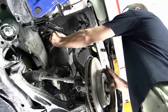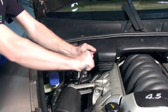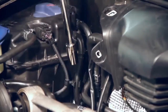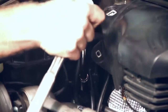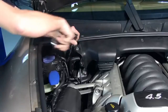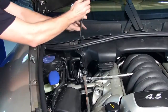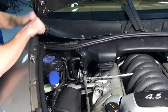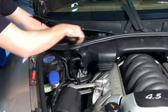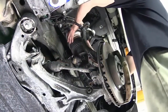Remove and disconnect the shock damper sensor. Disconnect the ride height sensor connector. Remove the three mounting bolts that secure the air strut's upper mount. Remove the rear bolt assembly from the vehicle.